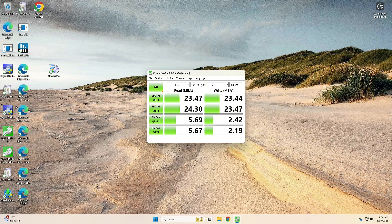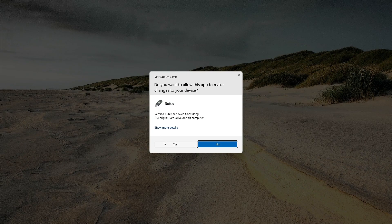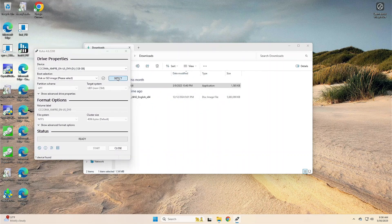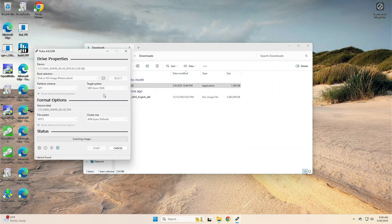What we'll need is two things: the latest version of Rufus and the latest ISO for Windows 11. I went ahead and used the 24H2 release — I'll include links on how to get both. We'll launch Rufus and select our ISO, and it goes through some processing while looking at the drive.